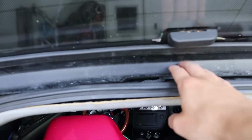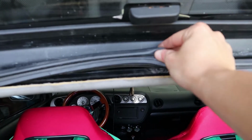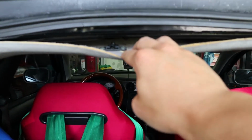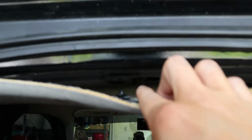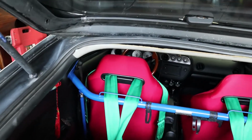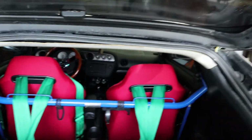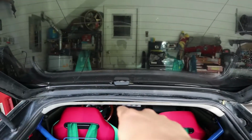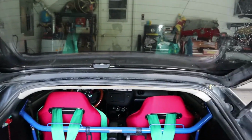The second harness here is right here. You'll just lift your gasket here, pull down a little bit on your headliner, and then you can see there's a connector back here you'll disconnect. So you'll disconnect that connector, and then you can also get to your bolts there too. So yep, that's what we're gonna have to do is take these off. So I'm gonna go do that, disconnect that wire harness, and then I'm gonna unloosen those bolts.